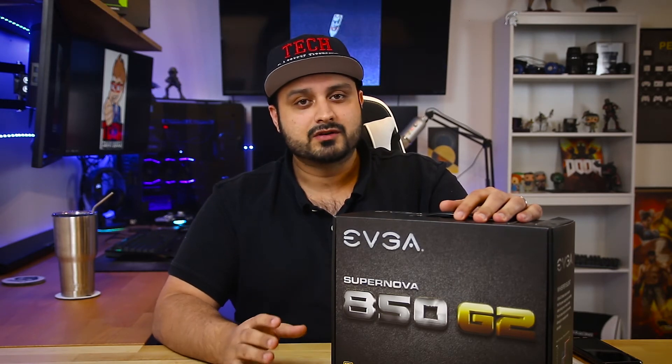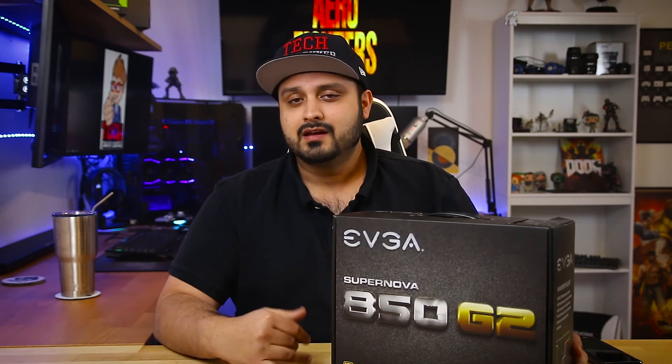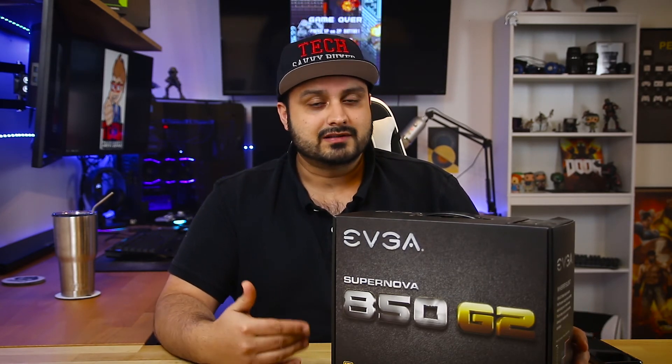So which one should you buy? If you want to save money in the long run and make your system as efficient as possible, always go with the power supply rated the highest. They might be pricier upfront, but rest assured that in the long run it's going to make its return just in the amount of efficiency it captures. For example, a gold-rated unit like the one I have here, at 50% to 100% load, is close to 85 to 87% efficient, compared to a basic 80 which would always only be 80% efficient. A little bit of math — calculating how much you use your system per day, multiplied across the year, factoring in the cost of electricity — can show you how much money you'd actually save by switching to a gold or platinum rated power supply.